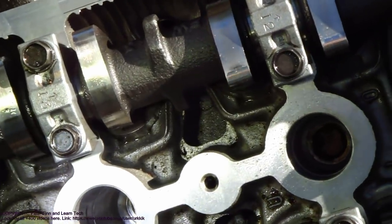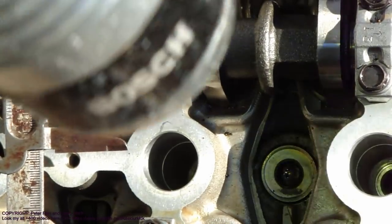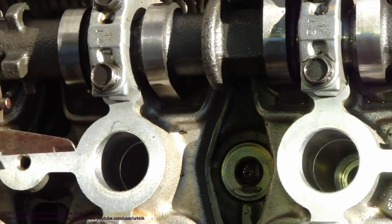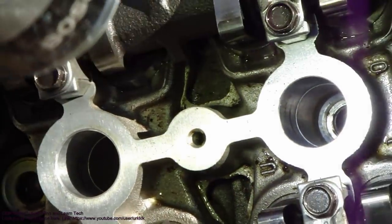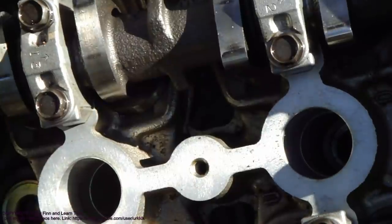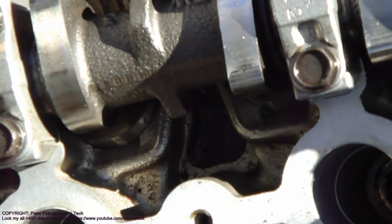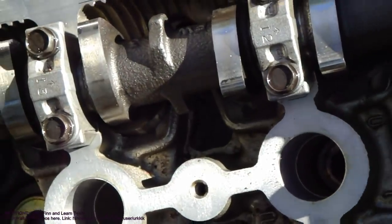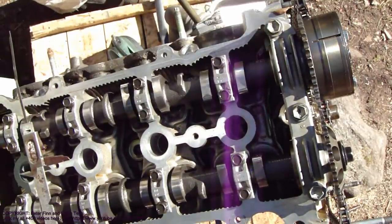And then when we look at this next piston in here, we can see that this piston is much deeper, and in that way we can think now that this piston is in that hole, that it is up. It's really important to know that this piston is in this timing chain setup in this up position in here, number one. And then there are other ways to check this.